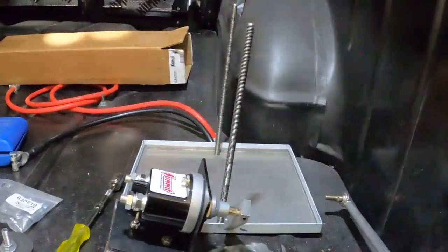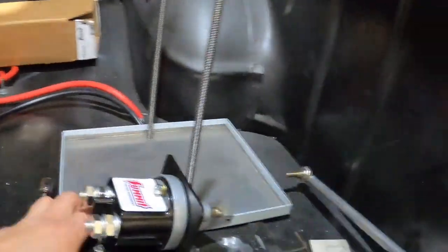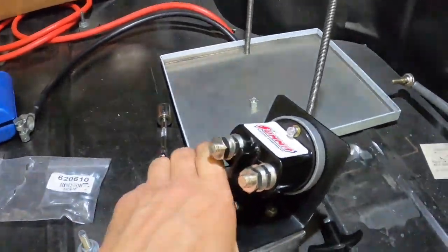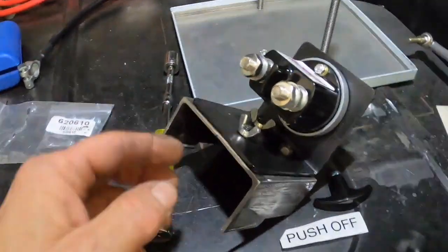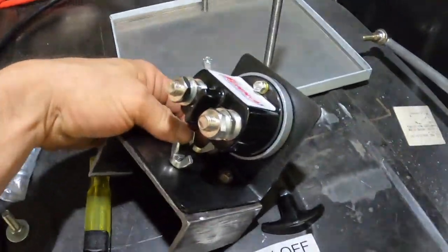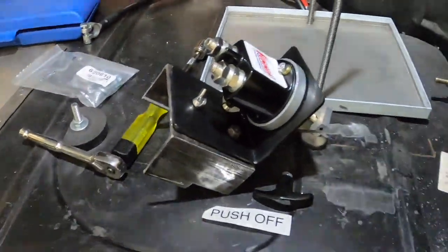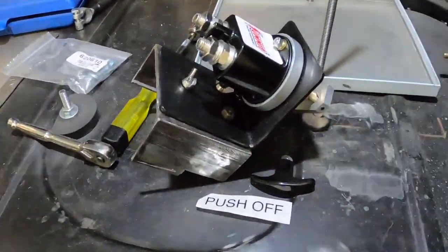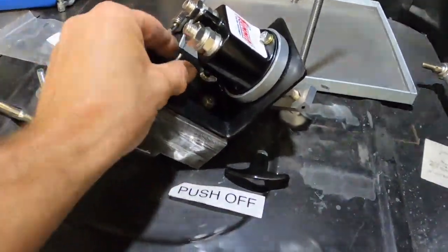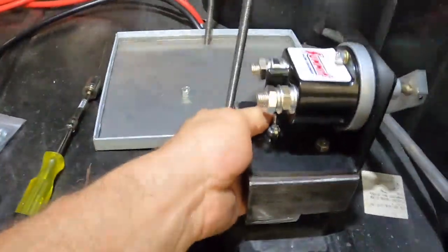When the car's running we want it on rubber — we don't want to be listening to that stuff. So I went ahead and fabbed up a little bracket. I didn't have any channel, so I just welded a couple pieces of angle together and tapped some holes. I have next to no hardware — you can see I've got two wing nuts and one regular nut just kind of holding it together. Good enough for now until I can get hardware later. I drilled and tapped this, ran the bolts up through, cut them to size, and the nuts are just holding it on there to mock it up.